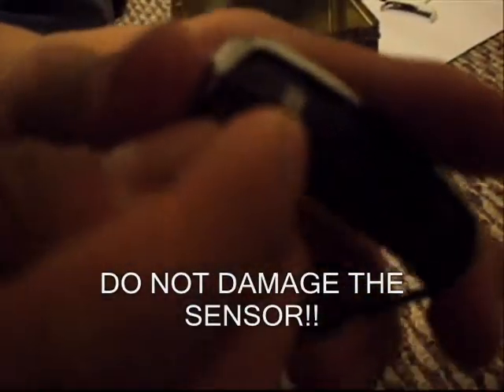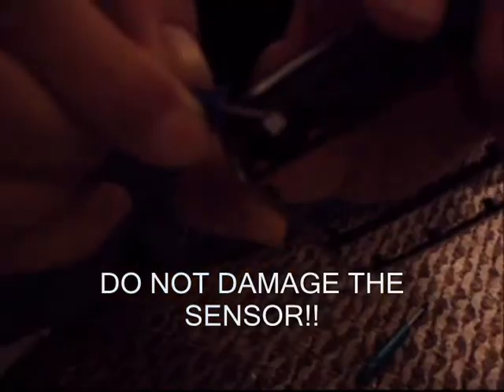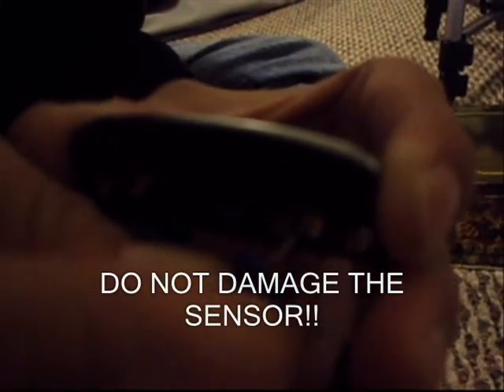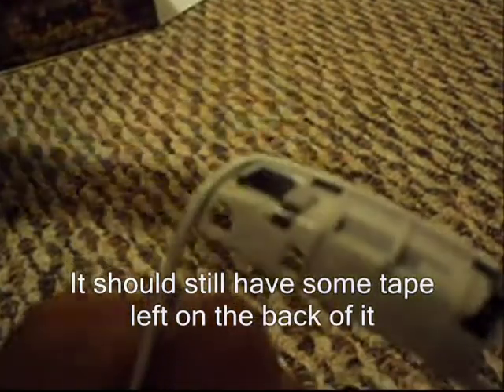What we're going to do is take this little pin and slide it under this little sensor, and work it for a while, nice and gently. Then go behind it as well and lift this metal piece off — make sure you're going underneath it and not just stabbing at it. Once you get it nice and loose, you can go right to the front and pull the entire piece right out. Now you just insert it through the slot right here, go nice and gently, and it should go right through. Stick it on like that, and now your button works because the sensor is on the other side. Take this piece and put it right over them — you can hear them click.